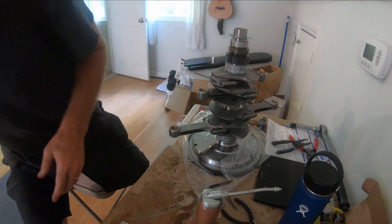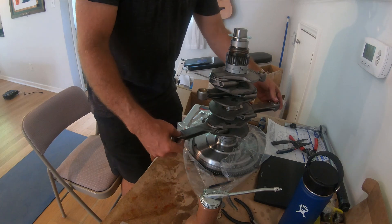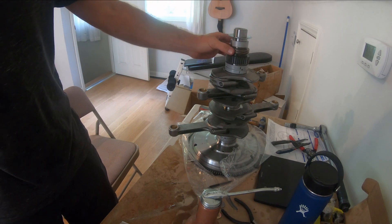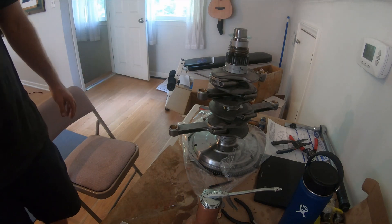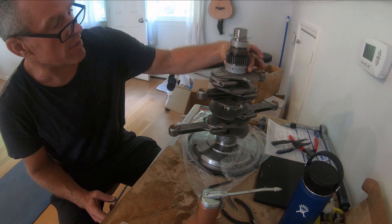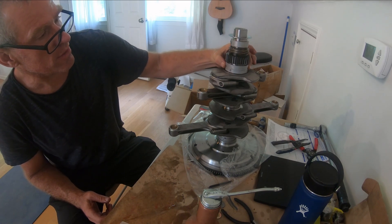It's possible I did the rods 180 degrees in reverse - I'll only know that once I get the case. The crank is set up with all the gears: cam gear, distributor drive gear, and the bearings are in and marked. Even though I didn't mark them from the case, I marked them visually so I'd know approximately where halfway was when lining up with the dowel pins.